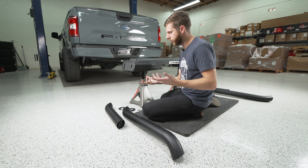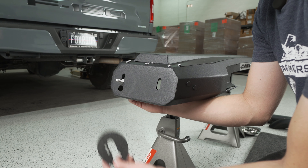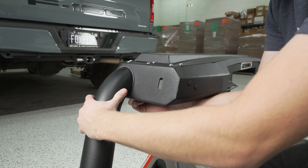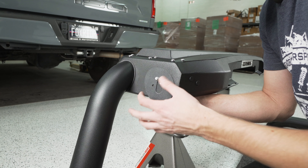First thing you're going to want to do is take the center portion of your sport bar and prop it up — I have it on some jack stands here, but it just makes it a little easier when it's in the air. I like to position it in the way that it would be positioned on the truck, so facing me would be the bedside, facing forward would be the back of the cab pointed towards the front of the vehicle. You're going to have a set of bars for each side and they are side specific, so you'll see inside the holes on these there's a little mark for passenger and driver. You'll have a shorter bar for the front — that's going to be up towards the cab — and obviously a longer bar for the back that's going to draw down and create that triangular shape. Just make sure you have the right ones for the right side, because your brackets at the bottom won't line up if you use the wrong bars. We're also going to have some plastic caps that are going to fill that gap and help it tighten up more nicely to the center beam, so grab those as well as the hardware out of your kit.